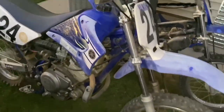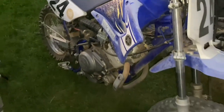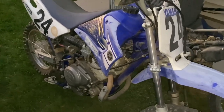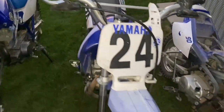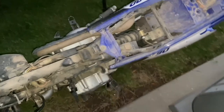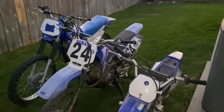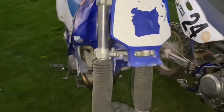This one starts up real nice and easy. They've all been sitting for two years — the guy was just able to get that one cleaned up for me. This one needs a carb clean, a soak, a new battery, new throttle cable and grip, basically the whole throttle assembly. This one needs a deep carb clean as well, and other than that it's good. Today I'm just going to be fixing them up and hopefully get these two running. I'll also have to put a new front fender on this one.